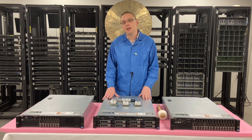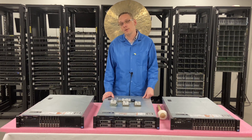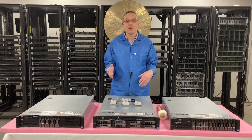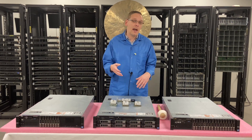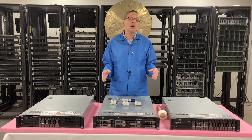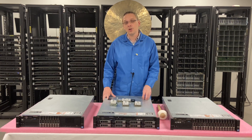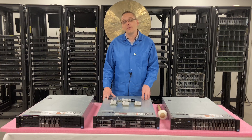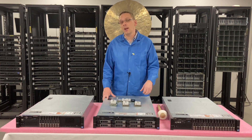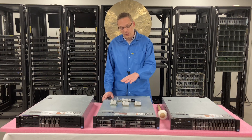This video is going to be focused on RAID. We're going to go over a couple things. We're going to show you the different types of RAID you can use for the R720, and we're going to put up a chart and compare them — the different RAID levels, the cache, the speeds, the PCIe version, all that. Then we're going to show you how to install the RAID, both the mini mono and a PCIe version, and then how to configure RAID. We'll end up doing RAID 5 with the H310.